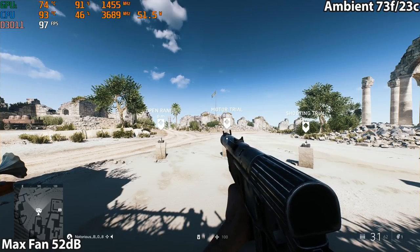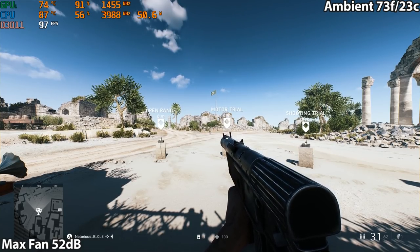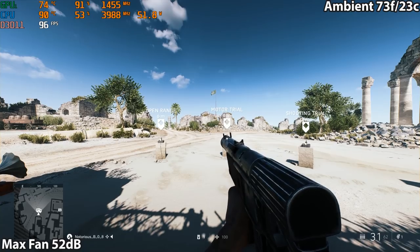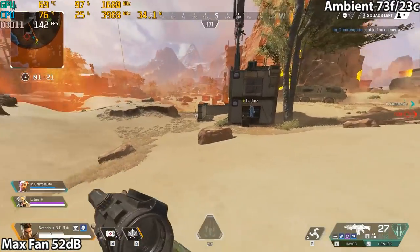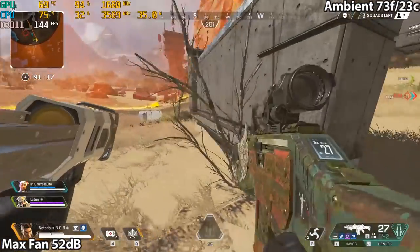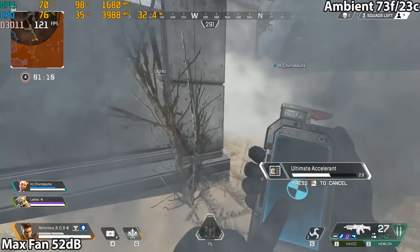Here's what gaming looks like: very high boost frequency with little to no power limit throttling at first, but as we hit that 74 to 75 degrees Celsius thermal threshold, frequency will throttle. As the system becomes more heat soaked, it bottoms out to 1455 MHz — still within spec for the 1660 Ti inside a laptop. I'm actually okay with this from a usability standpoint, but I want to know if we can use tuning guides with the MSI voltage curve editor and ThrottleStop to maximize performance.